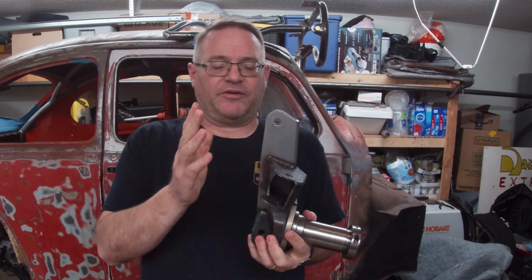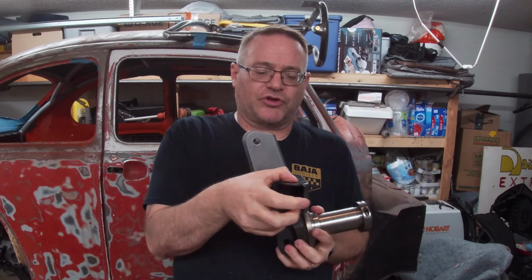Anyway, before I wrap up this video, I'd like to cover one more thing about the rack, its placement, and so forth. The only thing else I could really think of that you really need to know is the throw of the rack. The throw can be anywhere from like 4 to 10 inches or whatever. I'm not that familiar with racks to know, but how do you find out how much throw you need for your particular vehicle? To do that, I simply measured basically how far this traveled when I went from lock to lock. So this is me doing that.